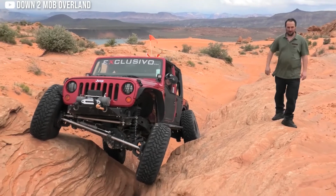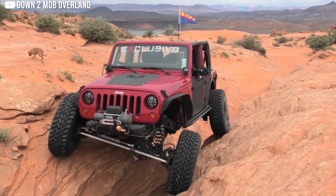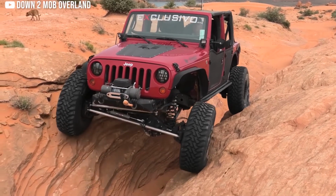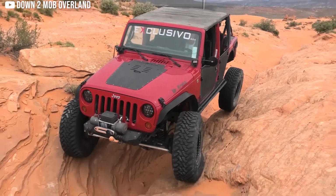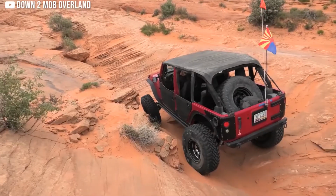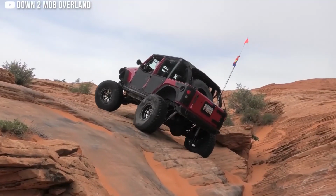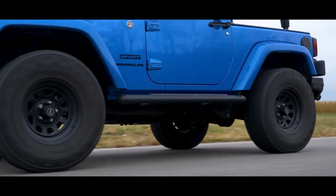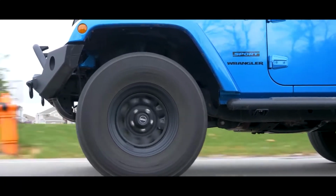As the axle starts to droop downwards, the control arm strays away from the horizontal plane, increasing the angle of the arm, and the downward force of gravity increases through the control arm. If the angle of the arm becomes too extreme, the force being exerted both from and onto the vehicle will become too vertical and will cause a harsh ride, poor handling characteristics, and limited suspension travel.